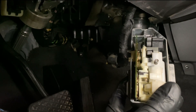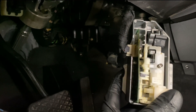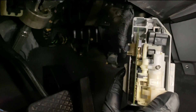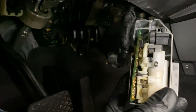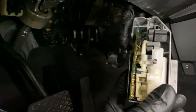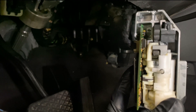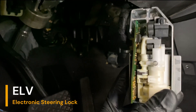Working on my own car today - this is an E61, 2005, the very first year. In September 2005 they started making these devices. On separate E90s and similar you generally have to replace the whole column. What's been happening is I've been getting the yellow CC message for a steering lock, and the fault codes show critical status.